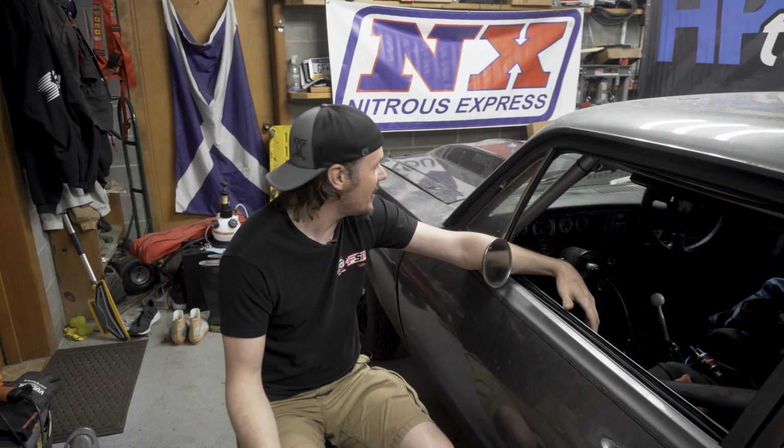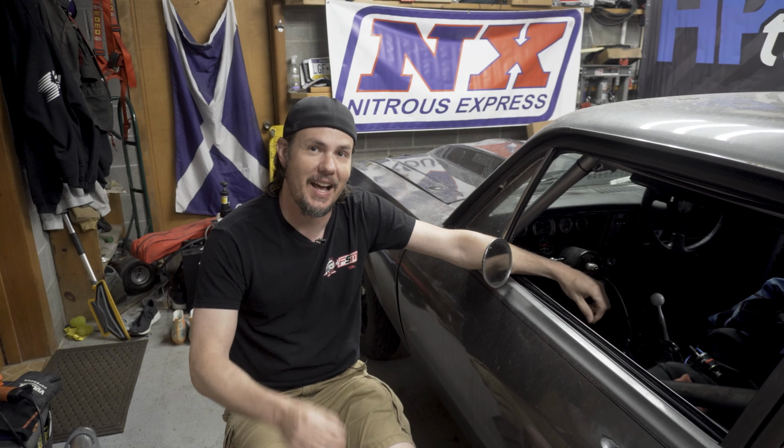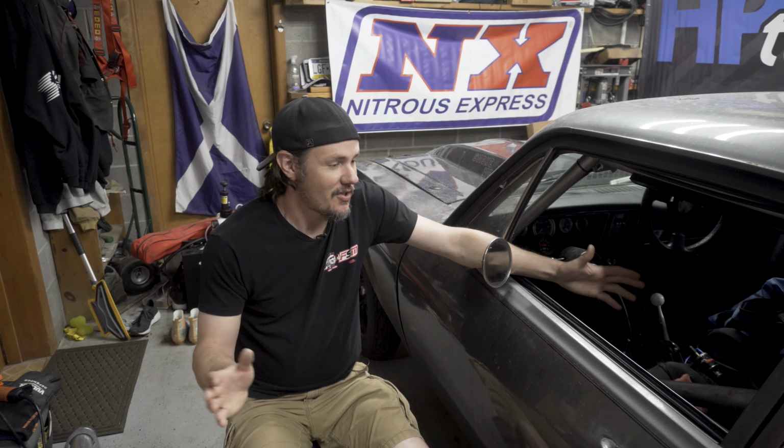We ended up being all right on the trip to Pueblo, but we were running without a hood. And I ended up sticking the air filter way up in the air, and by doing that, it cut like 70 or 80 degrees ambient temperature going into the motor. And then after relocating the oil cooler for the transmission, we were running maybe 205 peak temps as opposed to 225, which we were hitting beforehand. So that is definitely something that we're going to be looking at for next year. And in fact, I've already ordered a higher flow electric water pump to try and help with that. And as I said, we'll be doing some changes on the radiator mounts. So that is the big things that were killing us.